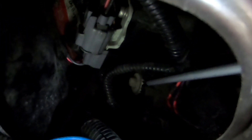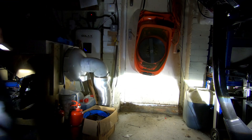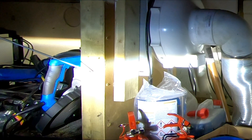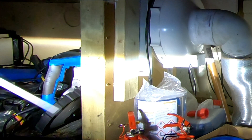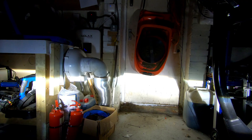This is why you need a big screwdriver — if you turn it for quite a while it adjusts the headlight. I'll demonstrate now with the headlights on. You should see the headlights there — that black mark is originally where the beam pattern was before I adjusted it, so I've moved it up a little bit, probably about an inch.